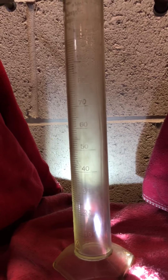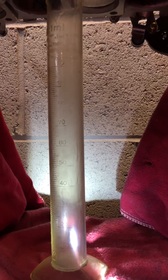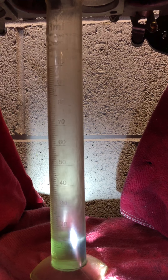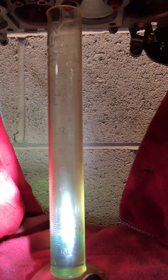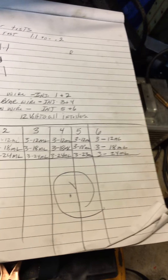Okay, here we go. We are on 50 pulses at 10 ms. One, two, three. And we have exactly 18 mL of fuel mixture, which I am recording on this little notepad here that I have for each injector at each setting.